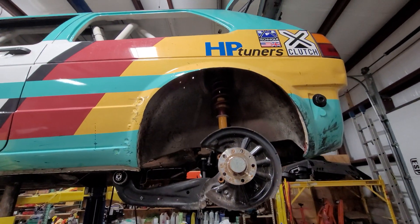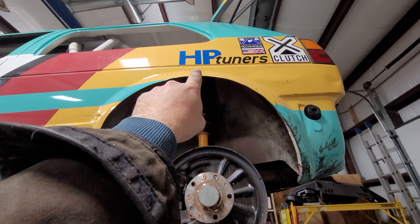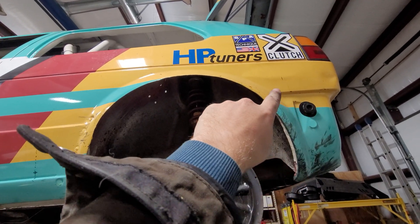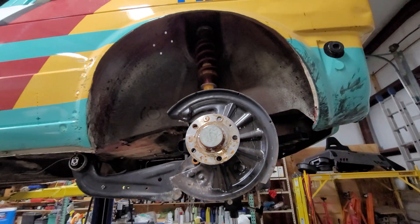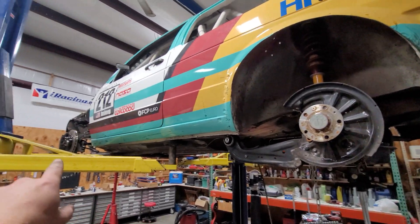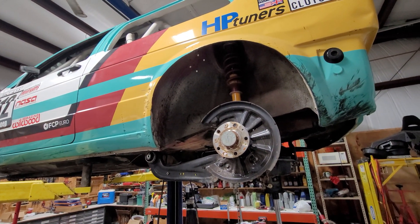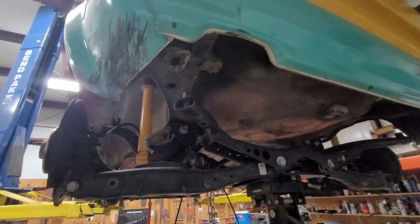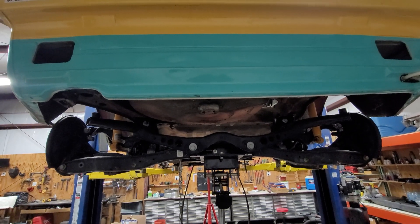The whole subframe needs to go up about 6 or 7 inches, which puts the top of an 18-inch wheel with about 3 inches of bump just to the body seam right there. I'm going to follow this green line and come back down to this OE spot here — I think that's probably one of the better-looking ways to do it. I did measure the front, inside hub to inside hub — it's about 63.5 to 64. This we measured at just 62.5. So we're pretty close, much better than before — 64 front width would help with turn-in, I believe, and add a bunch of rear stability.